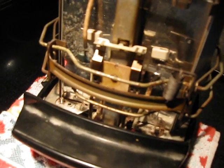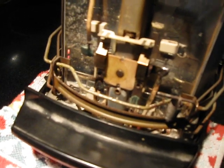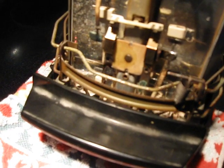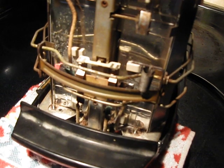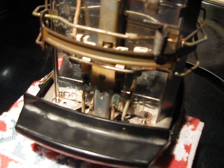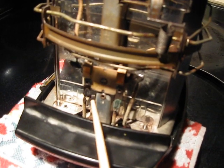Now we didn't actually trip the toaster here — all we did was cause the contacts to come up on each other. We can put it back down, let it up. All we're doing is pushing that strip in, which causes these contacts to come into contact with each other. Push it in — power. Let it off — no power. And it's that simple. If that doesn't work, then the problem is probably that there is no power flowing from the plug-in to these points.